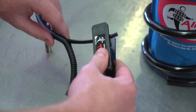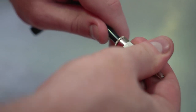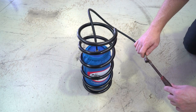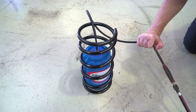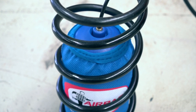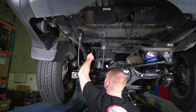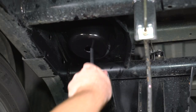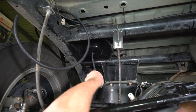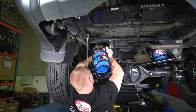This is also a good opportunity to leak test the airline connection to the airbag before reinstalling the coil spring, as it may be difficult to leak test once the coil is back in position. Ensure the inflation valve is connected to the other end of the airline and the airbag is inflated before doing so. Now that the airline is connected to the airbag, route the airline through the previously drilled spring seat and place the coil spring back into its original position.